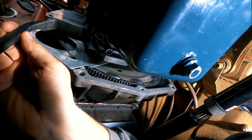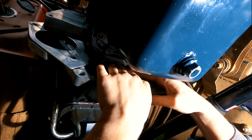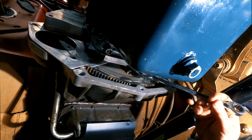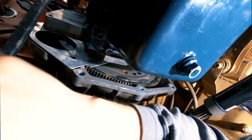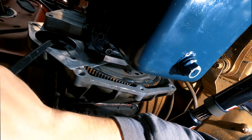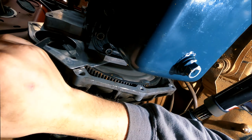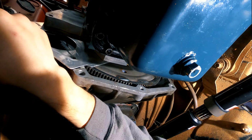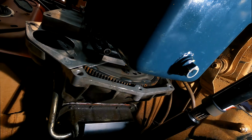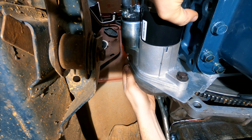While we were installing the skid plate, we found the bolts that go between the flex plate and the torque converter. So I first installed the bolts between the flex plate and the torque converter without cinching them down, so I could get all the bolts in without worrying about screwing up the threads. With all the bolts started, I would then tighten each bolt holding the flex plate with my hand. Next, it was time to install the starter onto the AW4 automatic transmission.